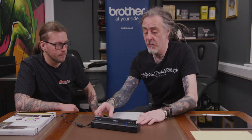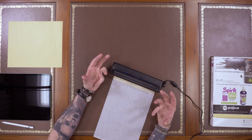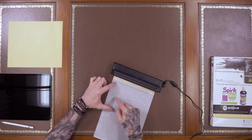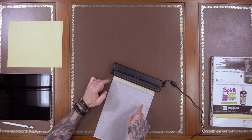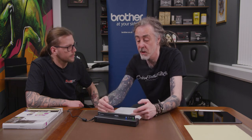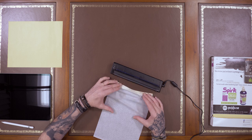Next troubleshooting issue: the print comes through but the paper creases. We covered a bit on ensuring it's straight — are there any other pointers to help prevent creasing? The first thing is to look at the mechanics: you've got a long thin printhead that gets hot as it reads the image. Where creasing tends to happen is when you've got parallel lines across the page. Take something like a flower of life pattern — every time there's a repeated joint crossing over, the printer is lighting up all the way across the printhead, like a speed bump.